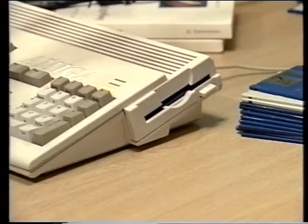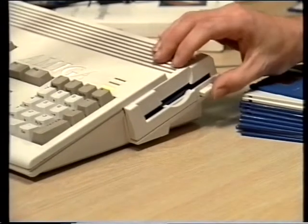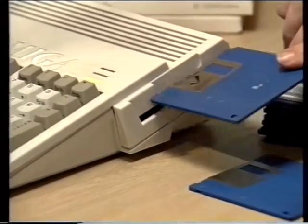To protect yourself against this, you need to buy a hard disk backup utility. A good example is a program called Amiga Pro. Using the backup utility, you can save all the data on your hard drive to a set of floppy disks. The backup utility makes it easier by organising all the data on your hard drive so that all you need to do is sit by the computer and feed it a fresh floppy disk every time it asks for one.